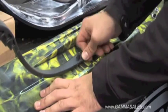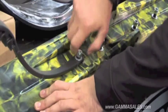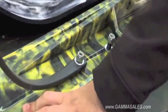One quick tip when you're going to go and install your Sly Dogs: when you're putting the carbide in the ski, the front stud on the carbide actually holds the ski loop on. There is no bolt that goes through there, so just keep in mind you have to use the front stud to hold the ski loop down.